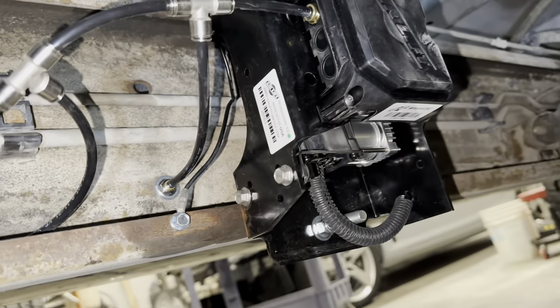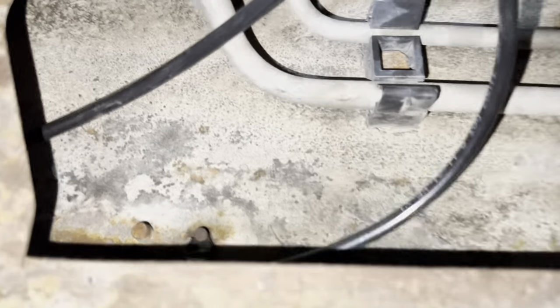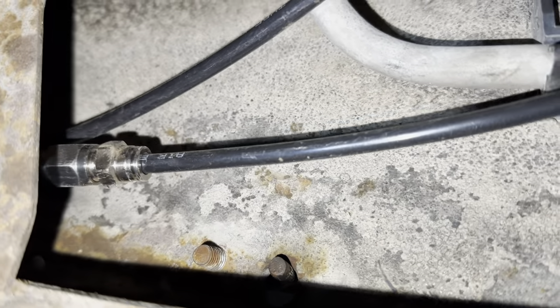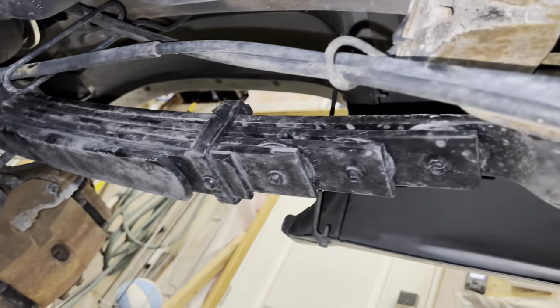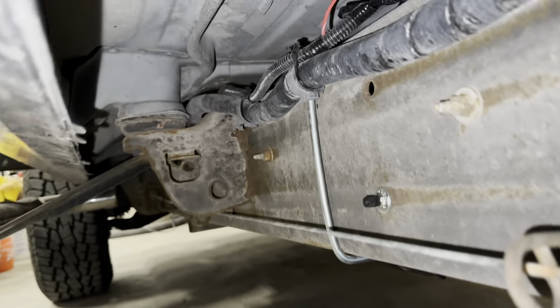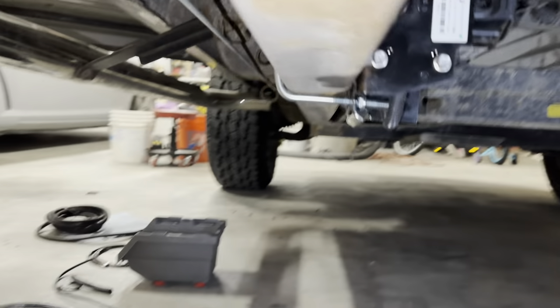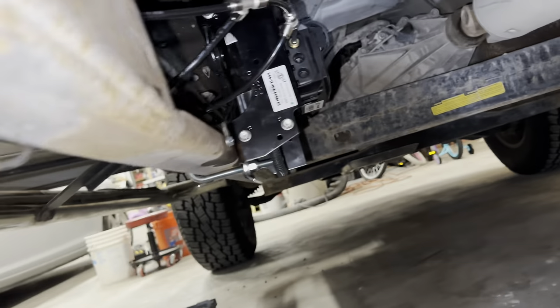There's a better picture of that compressor. It is kind of loud — my other one was pretty loud as well — but both those cables come in here. That one's almost long enough to come in here. The braided cable — the other braided cable — both of them just run up through here. That other one, I just put a splice up in that beam somewhere. I'm going to put a valve here so that whenever the compressor ever goes out, you can just hook in right there and test it out. I'll put some wire loom on this to protect it. After I test it, I've got about 20 psi in it right now. We'll kick it on and throw some soapy water on it — give it a little test. Should be good to go.